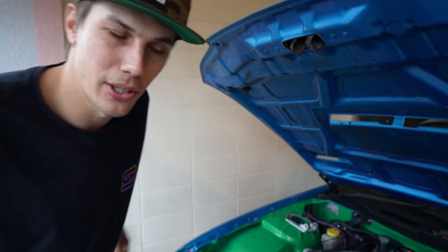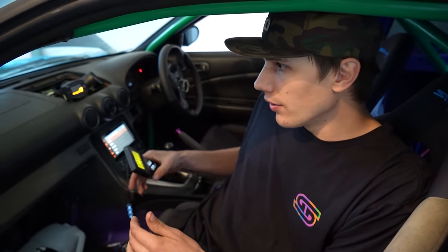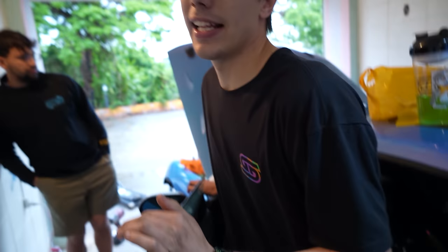The oil filter's already pretty warm so we know it's pumping everything through, which should get that last bit of moisture out trapped around the engine. What I'm working on now is through the Apexi hand controller - I'm taking out about 5% fuel up until about 3000 RPM. That's going to make this thing idle and run a little bit more responsive. It's not going to stall out as much because it's been running really, really rich. I want to make sure those plugs aren't going to get fouled out while it's being transported. Generally SRs when they idle should be idling quite lean at around 16 AFR - that's what Okachan's always taught me.